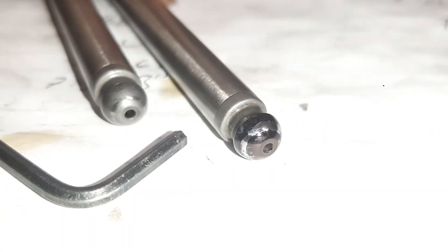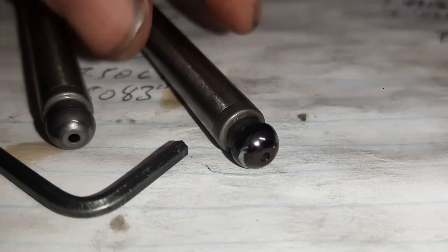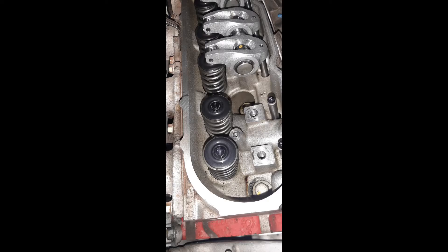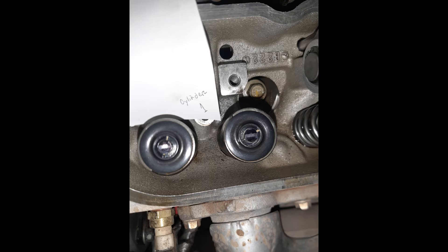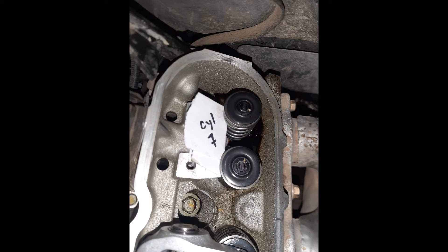The only thing that was a little confusing is the very end of the pushrod didn't perfectly mate with the rocker arm cup — but maybe you want a little oil in there to help protect the mating surface and ride on a fluid film. In these pictures, I'm checking the rocker tip wipe pattern. You want it centered on the valve tip; if it's too far one way or the other, it's going to side-load the valve guide, which is not good. You also only want it to be a certain width — I believe the instructions say 60 thousandths, but read the instructions yourself. If the wipe pattern is off, that's what the spacers in the kit are for — you can raise up the rocker arms slightly to get the correct orientation on the valve tip.